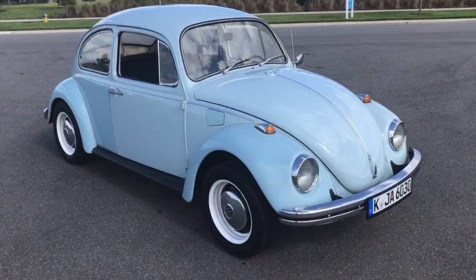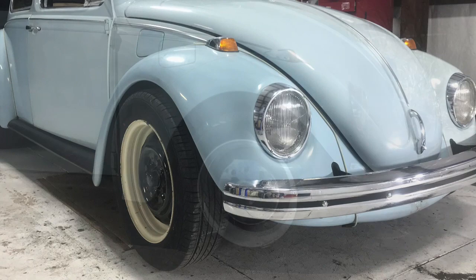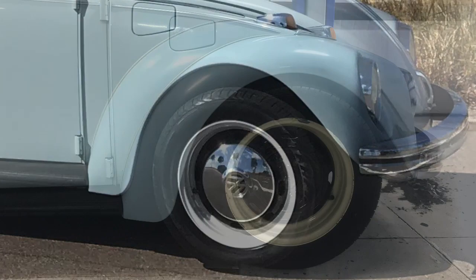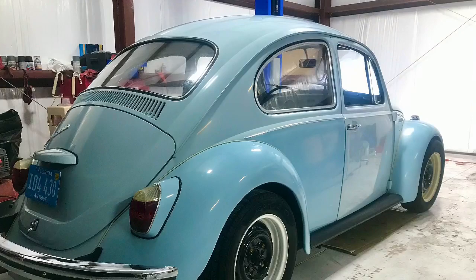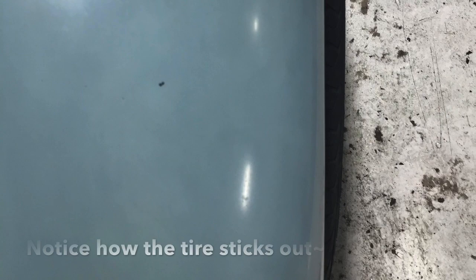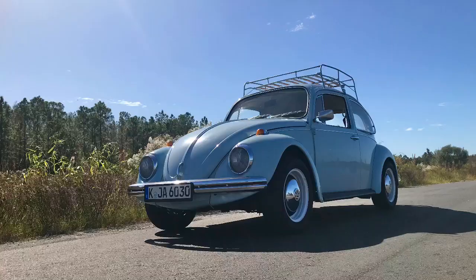After a lot of hours of work I was able to complete the job. One thing to point out is that these spindles push your wheels out a little bit. In my case with five and a half inch wide stock wheels, the tires were sticking out past the fenders, making the car undrivable. I would have had to put lower profile tires on, and I didn't want to do that. I was unhappy with the whole process and the quality of the parts, so I decided to put it back to stock — and the car looked beautiful at stock height.